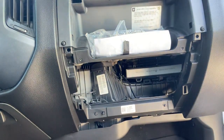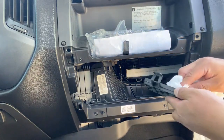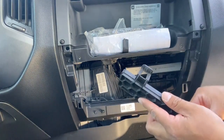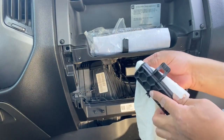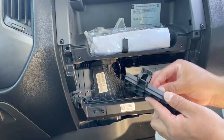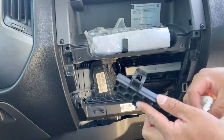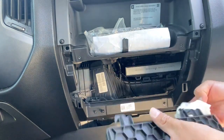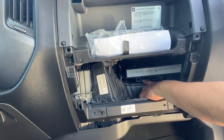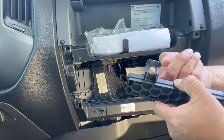Comment below if you would spray some of that air freshener solution in there. This housing area is actually a little dirtier than the filter itself. I have about 107,000 miles on this vehicle and this is the first time I'm changing it. It was okay but recently started to smell like a little bit of mildew. I always seem to run my vehicle with the air circulation set to internal. Now I'm putting these clips into the little holes — one on each side — and they'll go over the clip and snap into place.